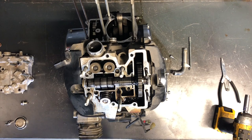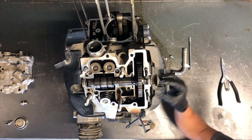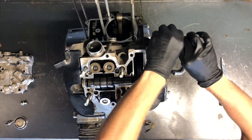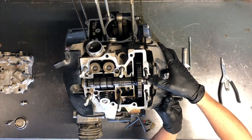Next, you're going to do two 10 millimeter bolts going into the back of the cylinder head and one in the cylinder. That holds the cam chain guide and tensioner. Go ahead and pull those — that'll loosen this up. You're able to just pull that out. That is for the cam chain. There are three or four Allens on the right side — the fin side cover. We've loosened several of these already, but go ahead and remove those now.